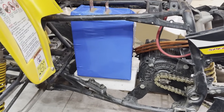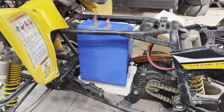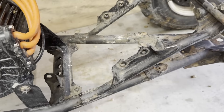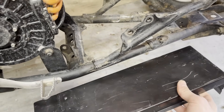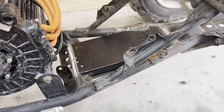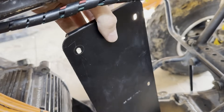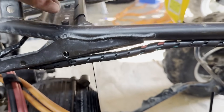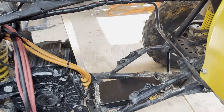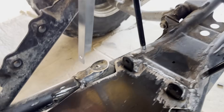When I test fitted the battery in the quad, I could see I'm going to have to remove these two little supports down here to get the battery to sit lower. I went ahead and made a foam representation of the battery because I was breaking my back constantly lifting it up. To make a platform for the battery to sit, I'm going to chop up the battery tray from my old Razor scooter. Once I got that attached, I started thinking about the back section — luckily, I had a piece from the Windone E2 e-bike, so I'm just going to slap it on and bolt it on top. For the front, I'm going to stick some aluminum pieces on the stock mounts, and on the bottom, I welded on some mounts that I cut off from another point on the quad.